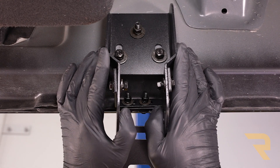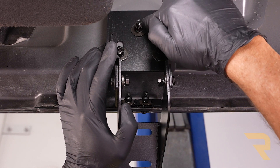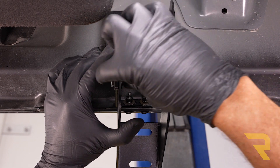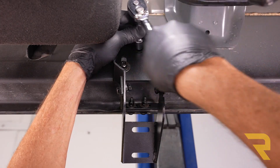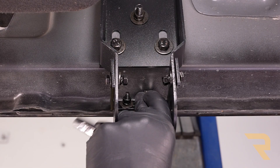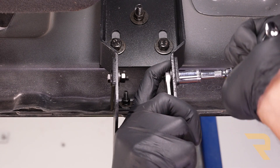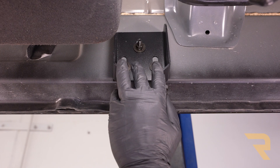This is actually a smaller nut and smaller bolt than what was on the single bolt plate. Go ahead and raise it up, line up our support bracket to the pinch weld, and just like before go ahead and install long bolts and all of their hardware. Now just like what we did before, we're going to raise up on our bracket, tighten down this hardware first. All three of these are going to use a 13-millimeter, and we can tighten down our pinch weld hardware with a 10-millimeter each side, and then 10-millimeter each side back here. Now if you have holes with no threads on all three locations, this is how you're going to install all three of your brackets.